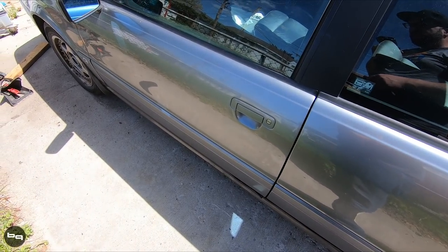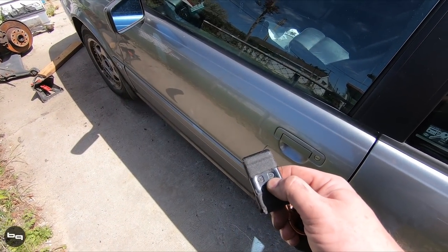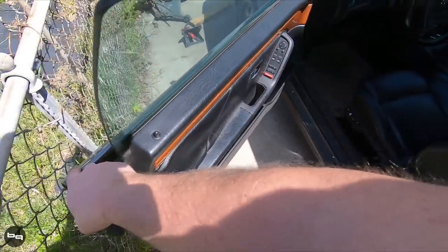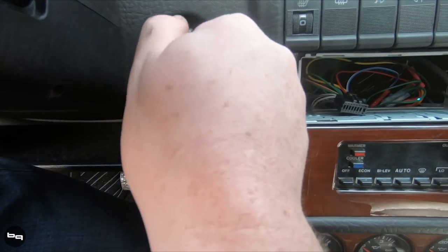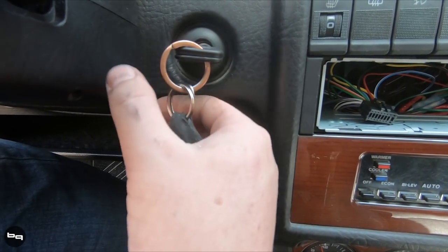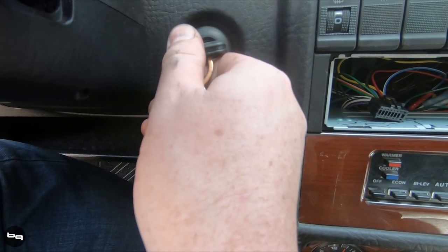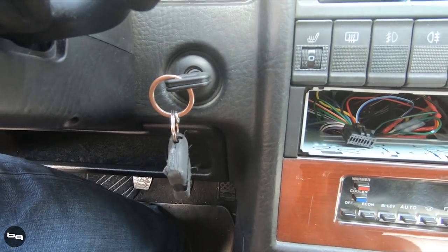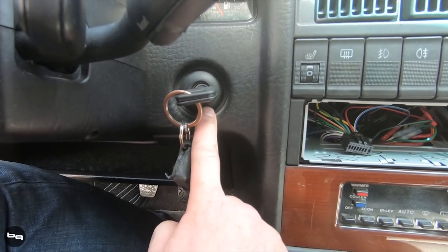I was playing with the paint - I haven't done this side yet, there's still a lot to do. But one thing that's been driving me crazy, besides the 90s alarm, is the ignition switch. The car actually starts up just fine, but when you turn the key it doesn't automatically click back like it should - it should click back over to stop running or trying to have the starter run. It doesn't do it automatically, and nine times out of ten it's the ignition switch.